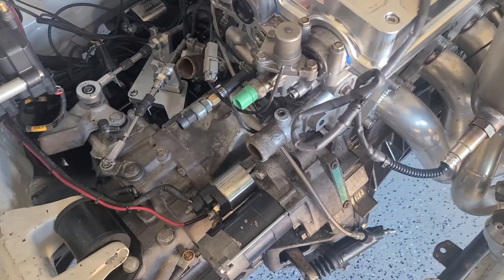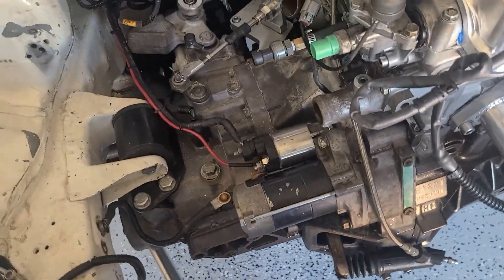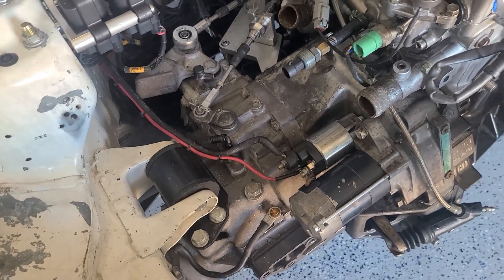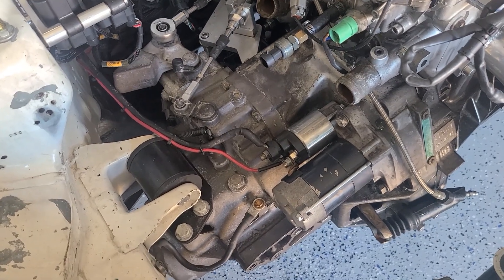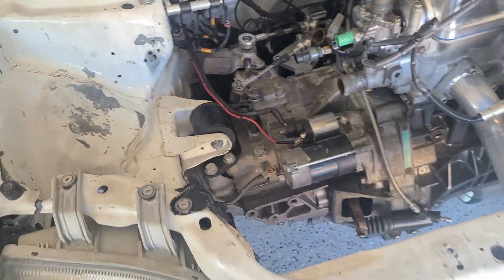In the meantime, we are going to rip this car apart again for at least the fifth or sixth time. I'm going to go ahead and drop the transmission out. I may just pull it back and drop it. I'll move the traction bar and I've got to disconnect the shift linkage, the rear motor mounts, take the axles out, half shaft out. So stick around guys, we're pulling a tranny.